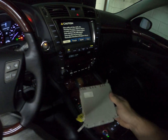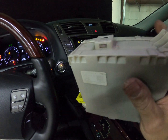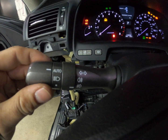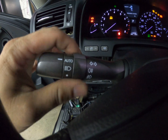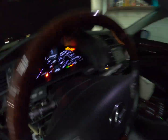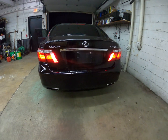The problem is if you go by the part number, it's not going to help you, because the part number is the same as the US spec body module. That really messed me up because I had no idea why they would use the exact same part number. Here's the European headlight stalk — you'll see it has the rear fog light icon on it, and it's a momentary switch. The first click turns on the fog lights, and the second click turns on the rear fog lights.